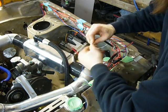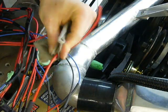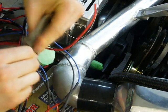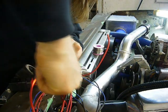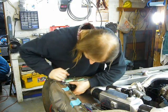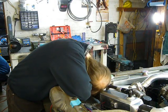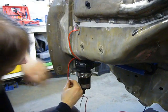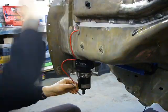This is the connection to one side of the relay contacts, which connects to the thicker 12-gauge constant 12-volt connection from the fuse box — this will of course power the pump. As you've seen me do in the past, all of my solder joints get a healthy cleaning with flux remover to get rid of that corrosive solder flux so it doesn't wick back into the wire and start eating away the copper. With all the connections made, I can just cram these relays and the ever-increasing amount of harness back into the car. This stock hole where the turn signal and marker light harness pass through is perfect for running the power wire to the pump, and the ground wire will just follow the same route.